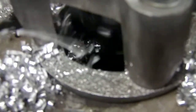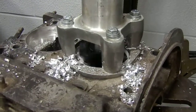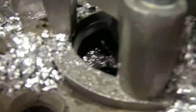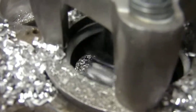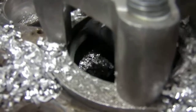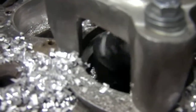We're going to continue cutting until I finish the overbore size and then we'll have the case prepared. You can see just below there's a dark area — that's where the original material was — and you can see the nice new step being cut in there, and that's going to be for our new bore size to fit the jug, the 92 millimeter overbore.